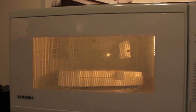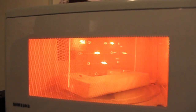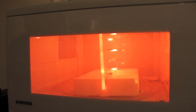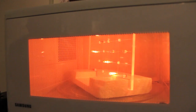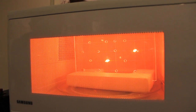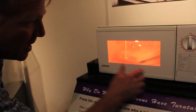What you see here is the beam traveling through the bulbs. The reason you have a carousel inside your microwave oven is because that beam always travels through the same path — it's just bouncing around inside of there. So if you didn't have that carousel and you put your cup of coffee in the center of the oven, it might not heat up correctly, because that carousel allows your cup of coffee to travel through different portions of that beam to make sure it heats up correctly.